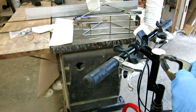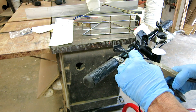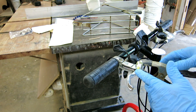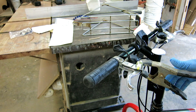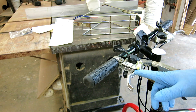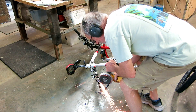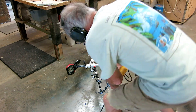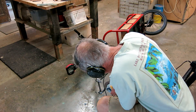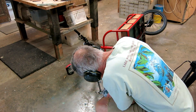I rotated the brake lever all the way around to access it better, sanded the little brackets down smaller to be neater, sanded the brake lever to clean metal, cleaned it with alcohol, and now it's glued on. Tomorrow I can glue the part on the lever and see how it works. The axles that came with the e-motor wheel are a little heavier and bigger than the originals, so they would not fit in the rear stays - I just had to open them up a little bit.